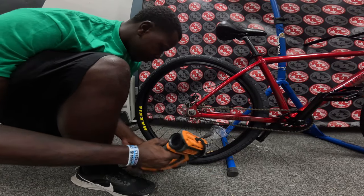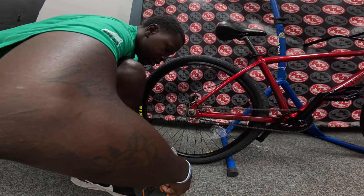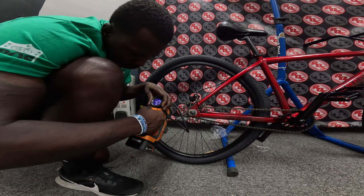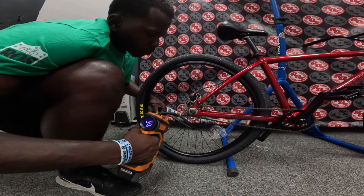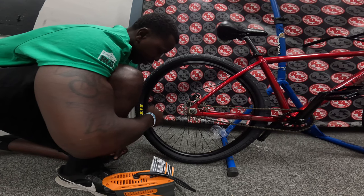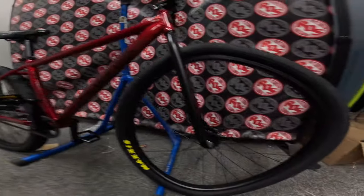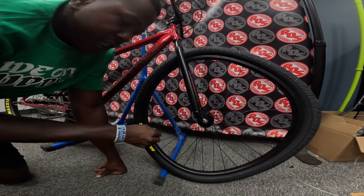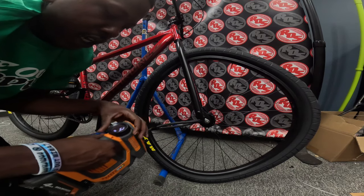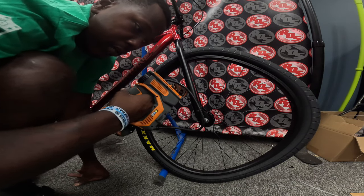Let's go ahead and get some air in these tires. I'm kind of different when it comes to tire pressure — I like more PSI in the rear than in the front. For the rear I usually do 45-50; just for the break-in and first ride on this bike I'm going to do 45. It didn't explode, so that's always a plus — sometimes I put air in brand new bikes and the tube decides to explode. For the front, just so the bike is easier to pick up when I wheelie, I'm going to put 35 PSI. I'll have a link to this pump in the description below.